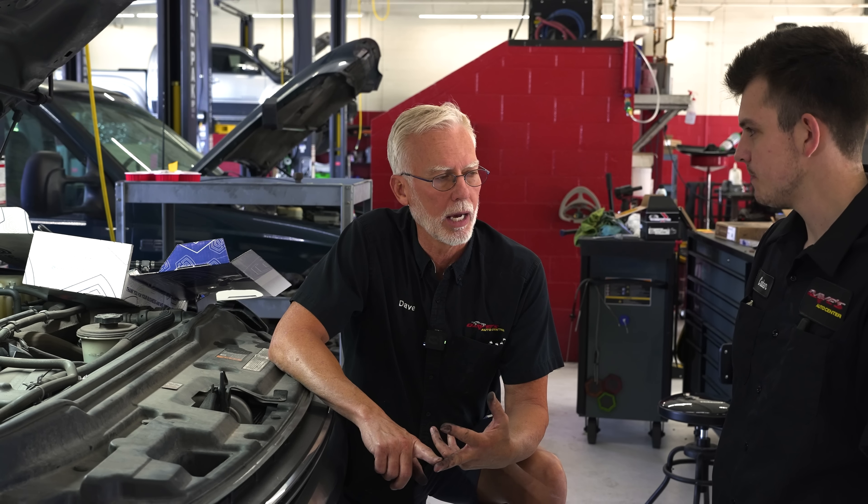How many miles does this truck have on it? 97,000. So he's doing this at the perfect time. If you're upwards of 80–100,000 miles — CP4s are on Dodges, GMs, and Fords, they're on everything. A lot of guys will upgrade them to a CP3. On the Ford, you can go to a DCR pump, which is a way better pump than the CP3. You can't do it on the Dodges and the Duramax — there's not enough room.